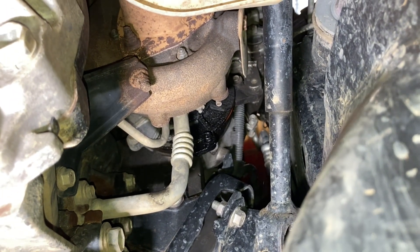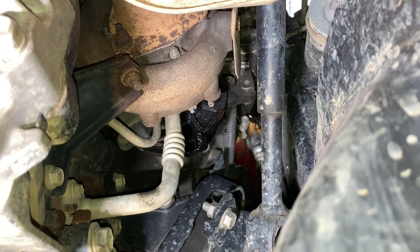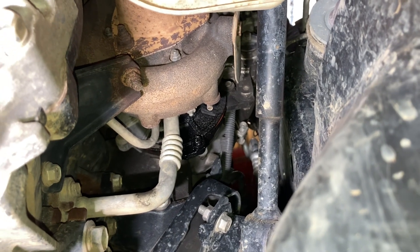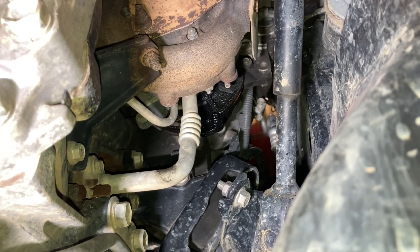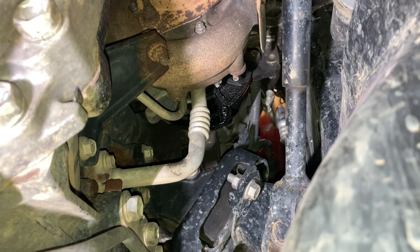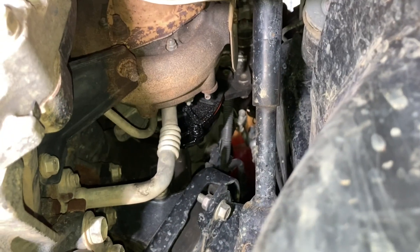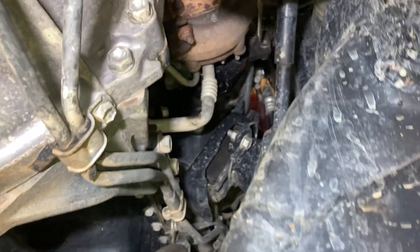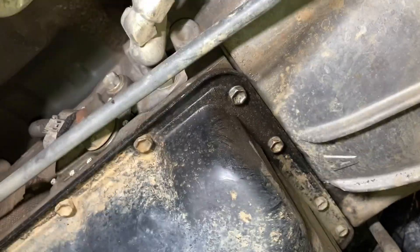It's not that common - maybe one in 10 or one in 20 vehicles - but enough of them have a bit of oil on the outside. It can be two things: either it's not sealed at the intercooler properly (remember that clamp earlier), or it's from the crankcase ventilation blow-by - that oil mist going through can cause a small amount of oil. Refitting that clamp could solve the problem. Even if it doesn't, you can clean it up and monitor it - it'll probably take a year to get that wet again.